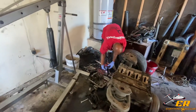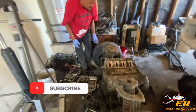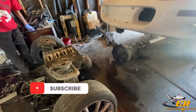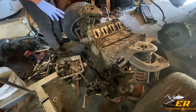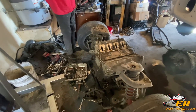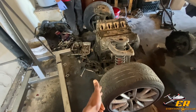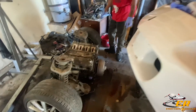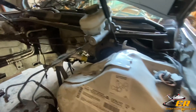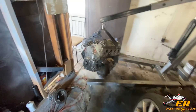So give him an update — I went to the auction last night, and it looks like you did a lot of work while I was gone. We got the transmission separated and took down all the accessories. Got the harmonic balancer already off. Now I'm about to snatch this old motor off. Then we got to swap out the rack and pinion, alternator — brand new — water pump — brand new — and all new gaskets. And of course we got all that on warranty. We'll be getting the engine bay pressure washed today, getting it a little bit cleaner.